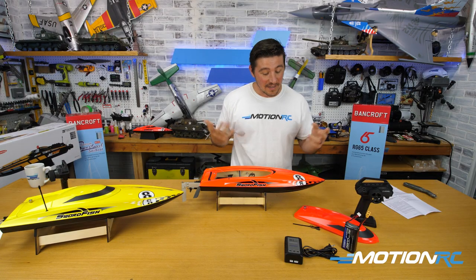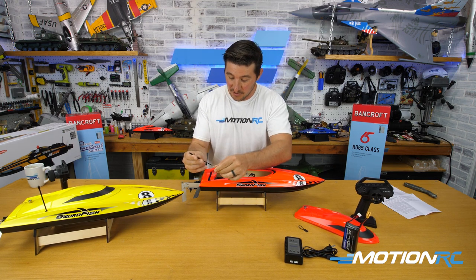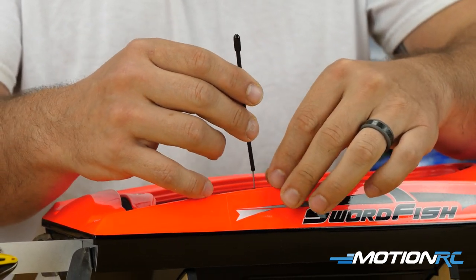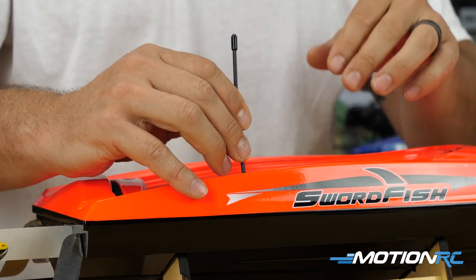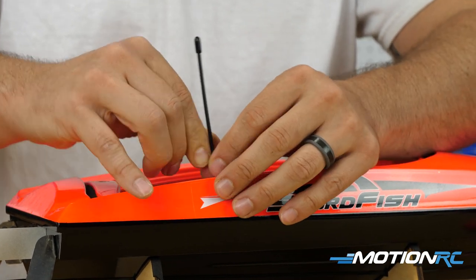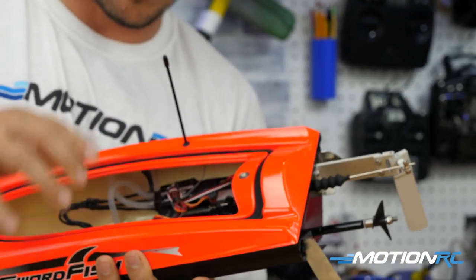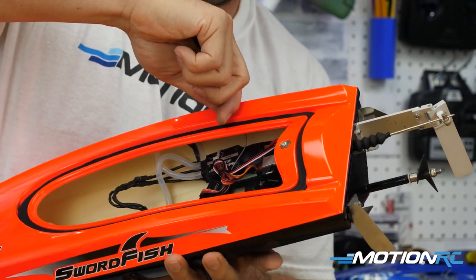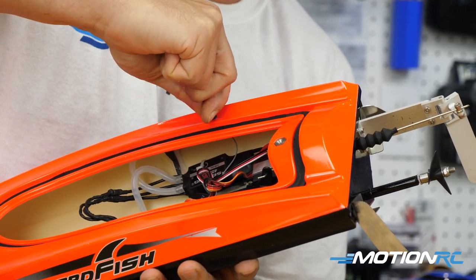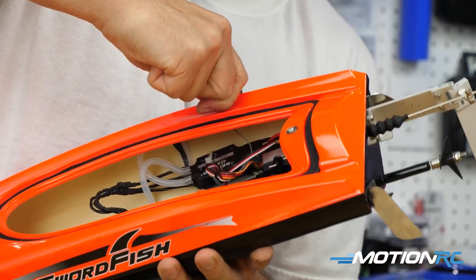For the last bit of assembly, slip the antenna sleeve — we call it 'antenna friend' — over the top of the antenna. Press down and note there's a specific direction because it has to be a tight waterproof fit. Hold it at the very base rather than pushing from the top or you'll bend the antenna. Work it around until it slips into place — there it is.